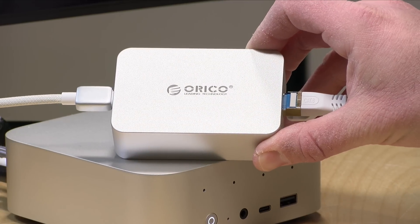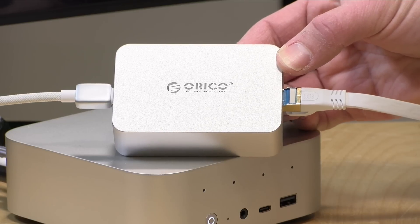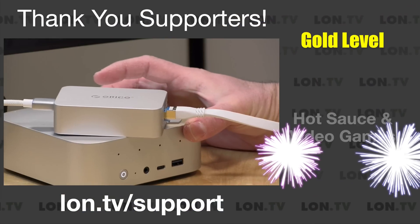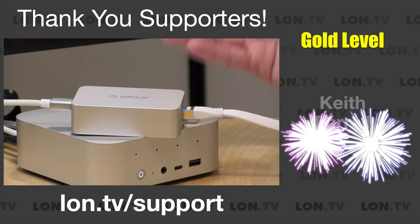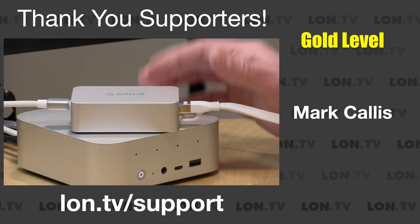This will work with Thunderbolt devices with 3, 4, or 5. It will also work with USB 4 devices but not USB 3 devices. So if your computer has USB 4.0 there's a good chance this will work with it, and in today's video we are testing it on a USB 4.0 based mini PC from B-Link. This is an AMD based machine with USB 4.0 in the back, and that's what we have plugged in here for this test.